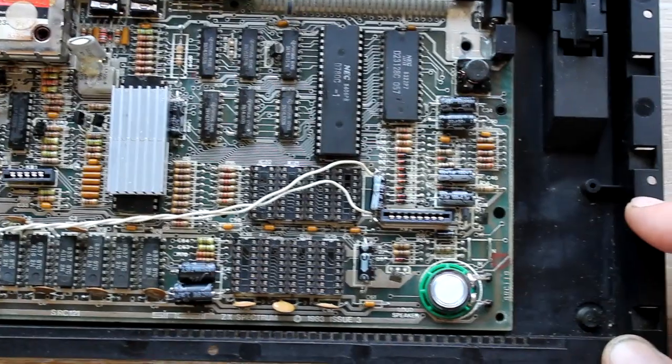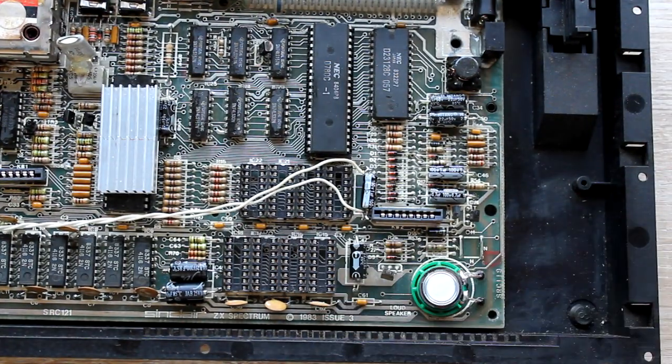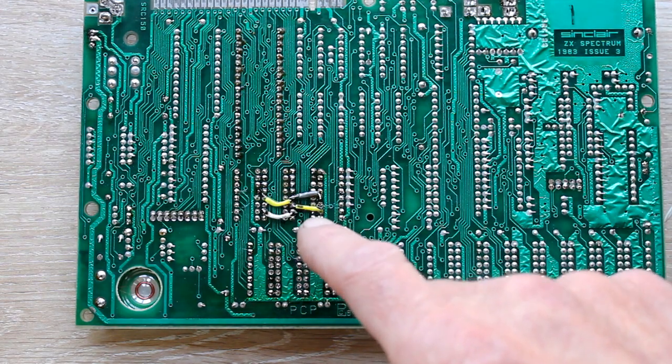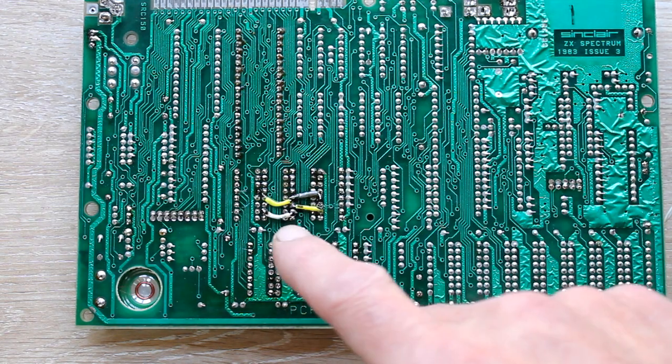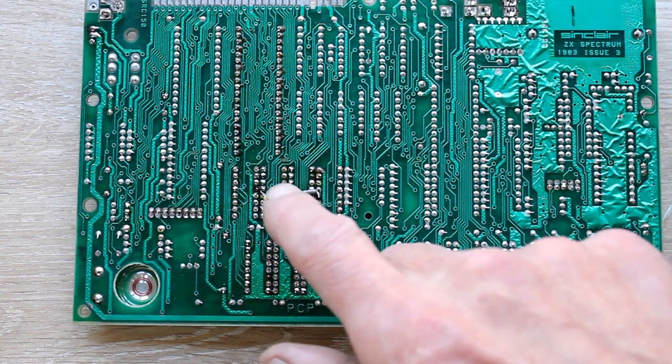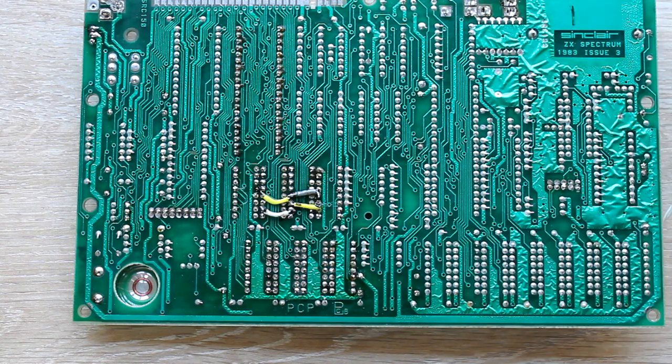You've got to have these logic chips in if you're doing the 16K upgrade from 16 to 48K, so I'll push it in the socket. I did damage a load of tracks when I was taking the last socket out and I've had to replace them all. I've covered it all with lacquer so it should be solid now, and I've checked all the insulation — there's no shorts across the pins.